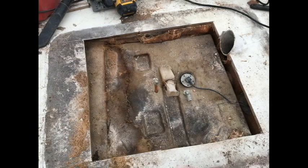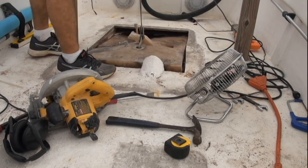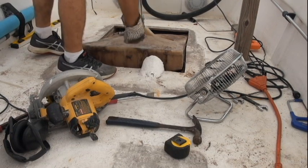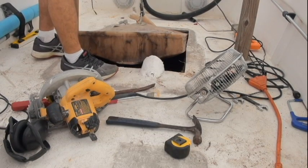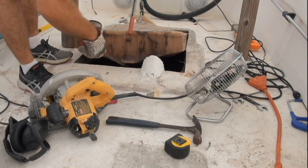I didn't want to cut too large of an area — just enough to be able to remove the tank. So I made this contraption so I could basically hoist the tank out of the floor, because it was tight. It had been in there for a long time and was wedged in pretty well, but this come-along worked perfect. Here you can see the tank slowly coming out. I was able to remove the fuel sender plate and then hook the hoist into that circle in the gas tank and wedge it up.